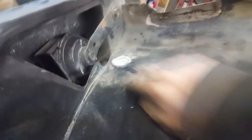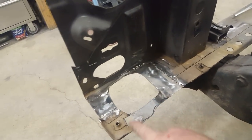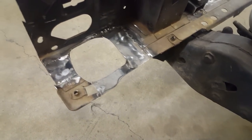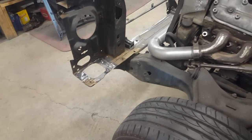I got that done - just welded a little piece on there and also welded up a couple holes. I used to have the washer fluid bottle there but it's not gonna fit anymore because of the cold side piping. I made a little piece on the other side so it's basically round. Now I'm gonna start taking it all apart - take the rad support out, take the other fender off, and then start taking the exhaust and turbo off to get that hot side piping on.